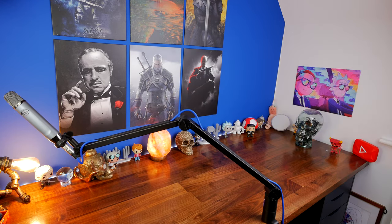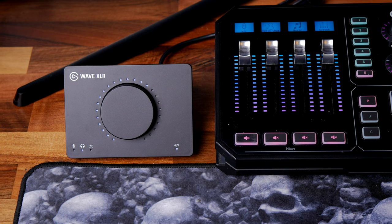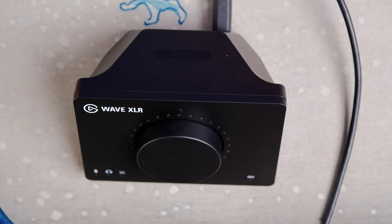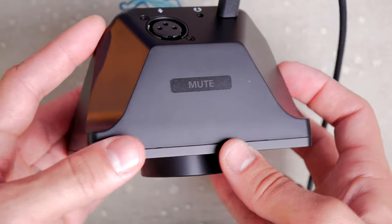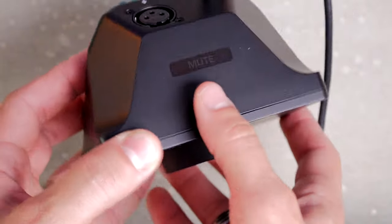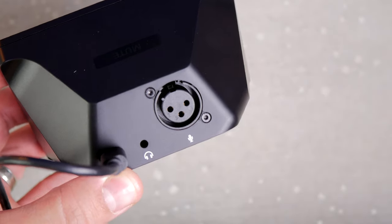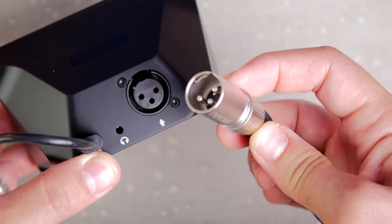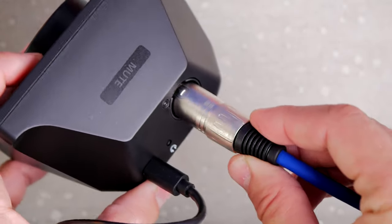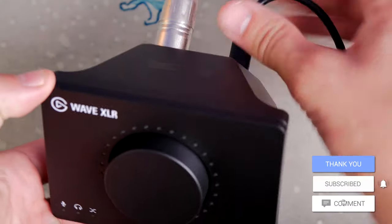The extra purchase here is you need an XLR interface if you don't have one already - the Wave XLR on the left, and then the larger, more capable GoXLR on the right. The Wave XLR is a really simple interface - basically plug your XLR cable into the back of it, mic monitoring via 3.5mm connection, and then a USB-C connection to your PC. It has capacitive mute functionality, and you can adjust the gain, headphone levels, and the mix between those two easily from the front interface. This interface also supports 48 volts of phantom power, so it is perfectly placed to work with this microphone. You need to make sure with this condenser style microphone that you get the gain as low as possible for the best results.